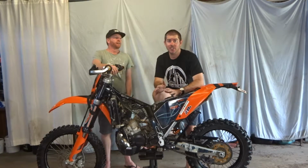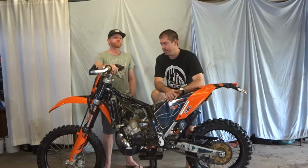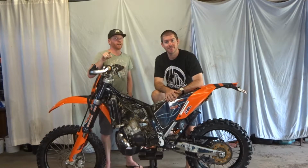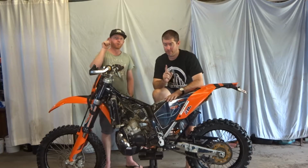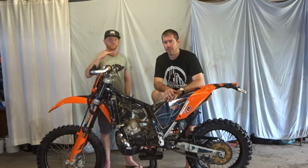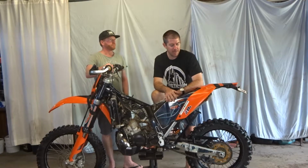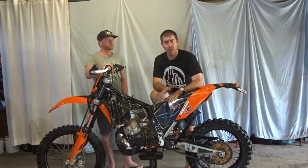Alright, so compression test, 102.5 I'm going to call. So, whoever got that, we need to see that. No cheating, no lying. Come on. We will know because there's a timestamp on when you looked at it and when you guessed. Yes, I can do that, YouTube analytics, crazy weird stuff. It's insane what we can do. Anyway, over 100 psi is no issue at all. I would not be doing a rebuild on a motor that has over 100 psi.